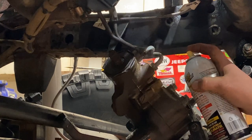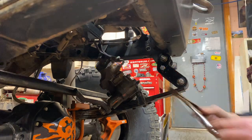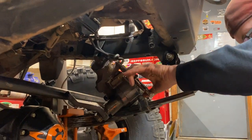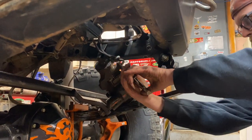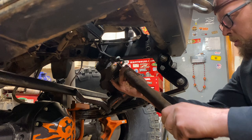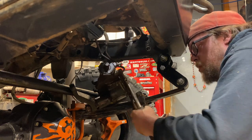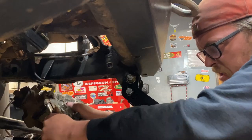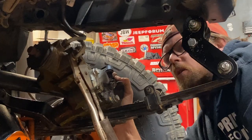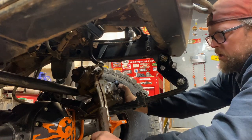I really don't recommend heating this up because there's seals and bearings in here, but I gotta get this thing off. So for my next move that I also don't recommend - we're gonna set the old vice grips on kill mode. My trick: set them so tight you couldn't possibly squeeze them closed by hand, but you can squeeze them with a lever. That is on there my friends. Get this down on here - look at that, mint. Just like I said, don't try this at home.